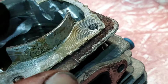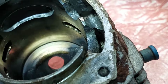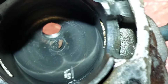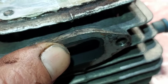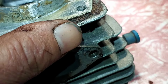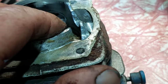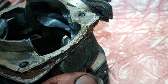So I'm going to put a big bore Lloyd Barn piston here and have a look where she goes. That's alright on the bottom side. There's my squish solder mark. I've got 38 thou squish. I want to try and take it to say 24, something like that, 22. This is my own personal saw, so just for fun, a pop-up piston, just for fun, guys.